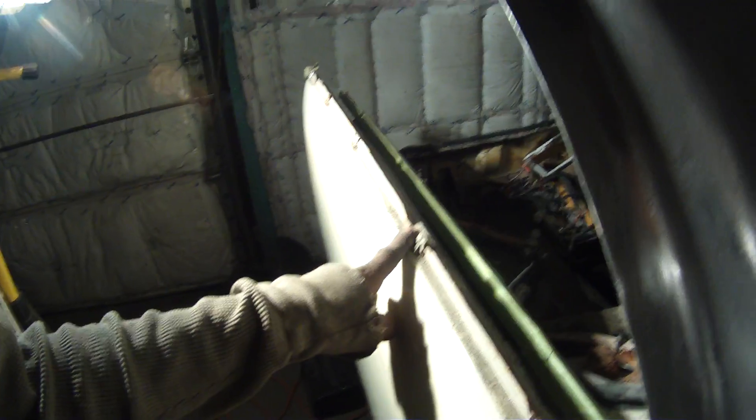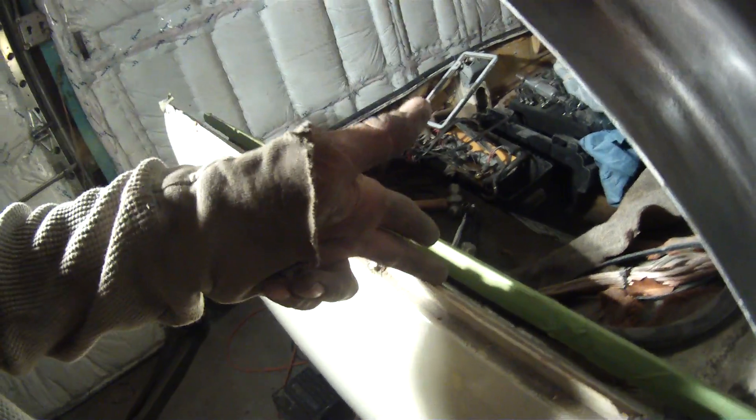I'm going to have a little more body work to do. I hit some lead joints. There's a lead joint here I messed up, and there's a lead joint in the middle of the quarter panel right here on this side. It's all lead. You've got sheet metal and then more lead here. I thought this was pressed all one piece, but this is lead — lead joint right here, lead joint right there. This is another piece; they're leaded together. How about that?